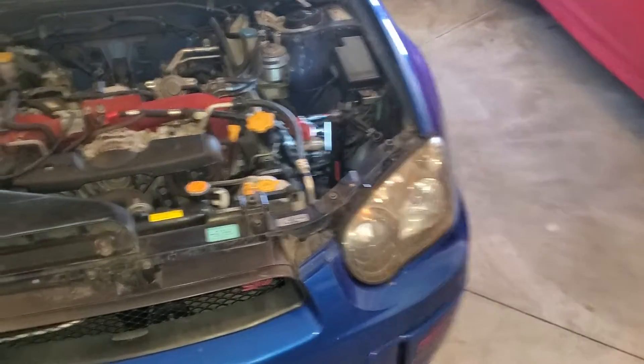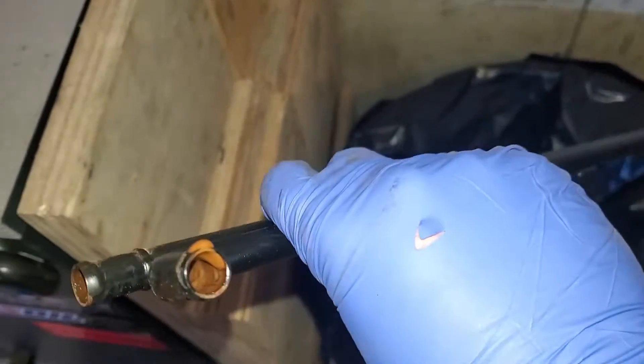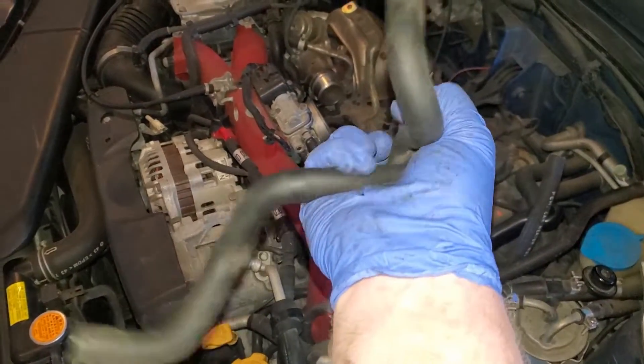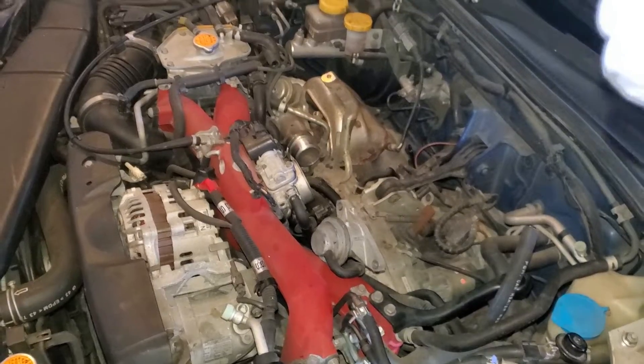After fighting with it, I kind of figured out what was going on. I got a lot of condensation in here — like a lot. I looked online and it is normal, especially with the PCV system, because it gets old, it gets cracked, and you get a lot of water in here. At first it was startling because I didn't see that much in any other car I've owned. Remember I was telling you they crimped this hose and nothing was going through it — so it was pressurizing — but there are also pinhole cracks and holes when I pressurize this hose.